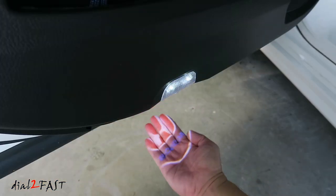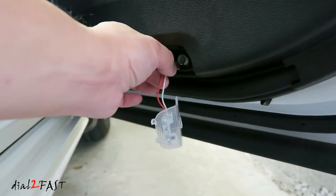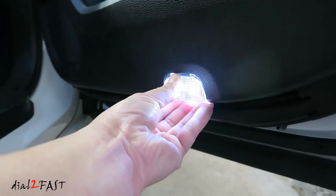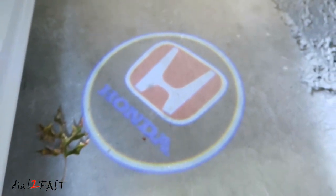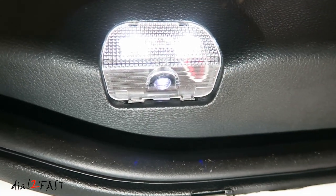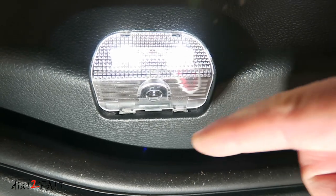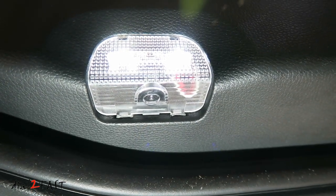Here's a look at the logo. Now repeat the same procedure on the other door. One thing I do notice is the two clips right here don't go in all the way. Now I don't see a problem with the light popping out, but if you find yours to be a bit loose, you can cut a small piece of 3M double-sided tape and stick it right on the tab right here and then push it in. That way you can still remove it if you need to later on.